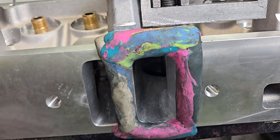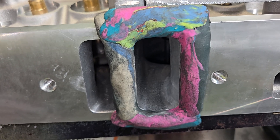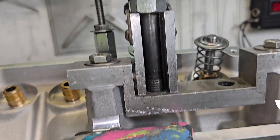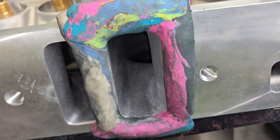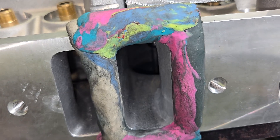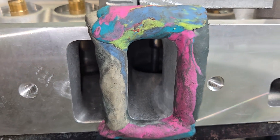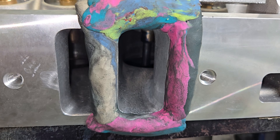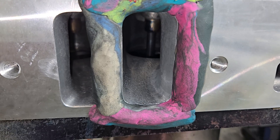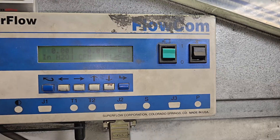We're going to do a second cut on the AFR Blue Hornet heads. The garage is already 88 degrees. It's set at 0.6 lift, which is within the realm of possibility for these heads. We're going to do the string test and take a look at how the string does. It's not going to be easy to film - I need to handle the string, the phone, and the light. Let's get started and turn the light off for this.